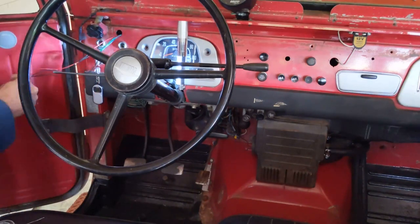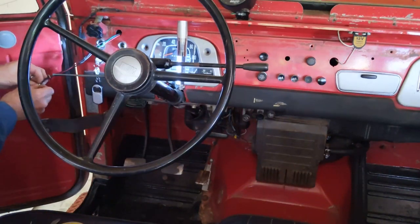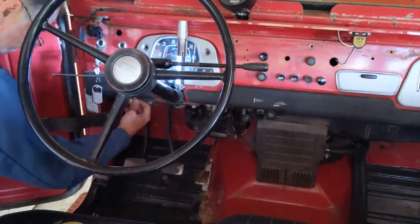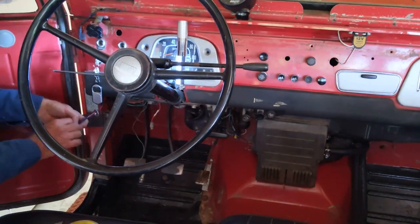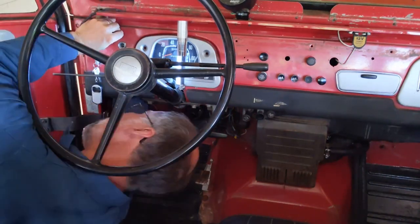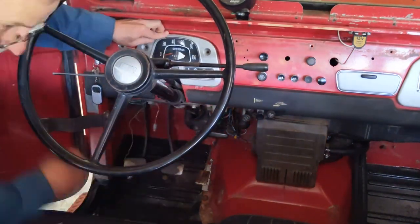I'll go up to the front of the vehicle, hook up the battery, and actually work the horn to make sure the lights working. I've gone back and forth testing things, then disconnected the battery for the final install. I've marked the three wires with pieces of tape, pushed them back through the hole, installed the locking nut from behind, fed them back up, and installed the switch, tightening the backing nut to lock it in place. Hook up the battery — yep, it's working. Now I can go ahead and button up the instrument cluster.